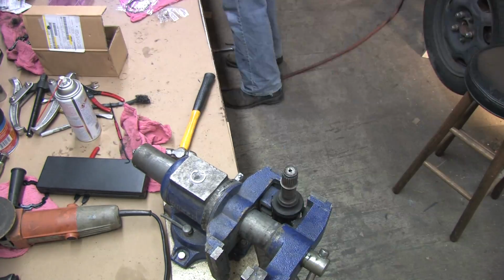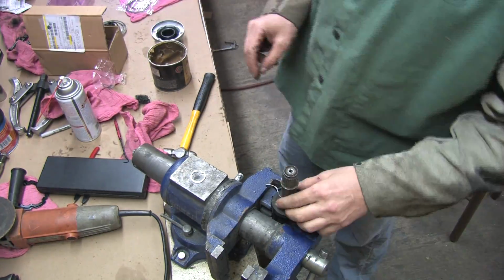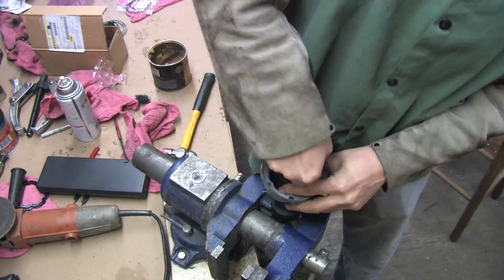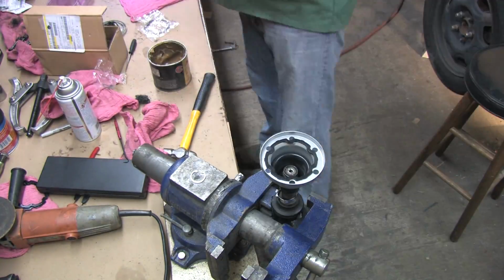Pay attention to lining up both gaskets, the bolt holes, and that the torque ring and clip are already past the boot before installing the Lobro joint. If you don't have those pieces in place first, you're going to have a bad time.